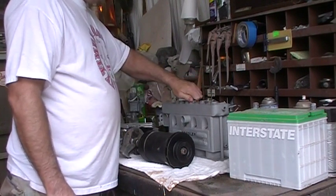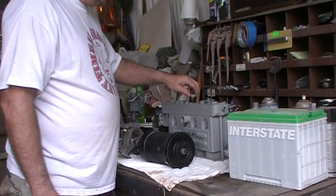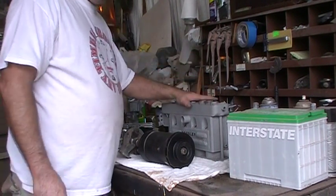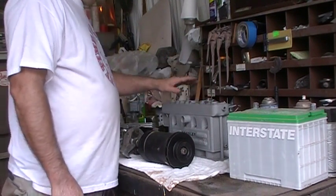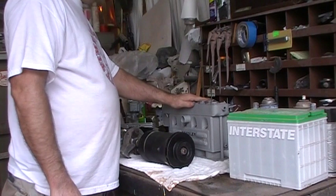Mr. Crosley and his team designed these valves to have rotators. Every time a valve gets pushed down it turns a little bit, and that keeps them from having burnt valves — which is what everybody had back in the day. This stopped that. That was a very good invention. I don't know if anybody ever caught onto that or not.